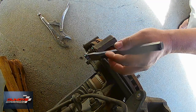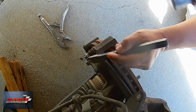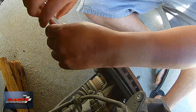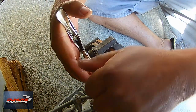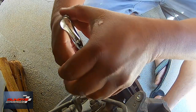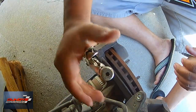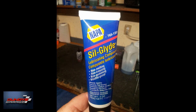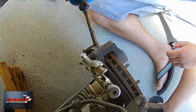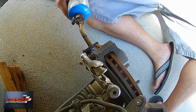But this will work for any make or model vehicle for getting the caliper slide pins out. And this is why you don't use axle grease on caliper slide pins — only use a designated caliper slide pin grease. The best one I've found so far is Napa Siliglide. Very easy to use and stays effective for years. Always grease your caliper slide pins so you can avoid problems like this.